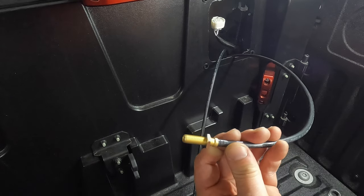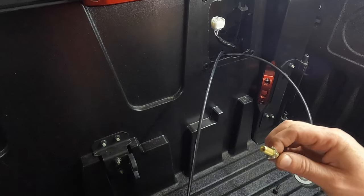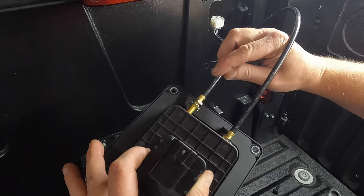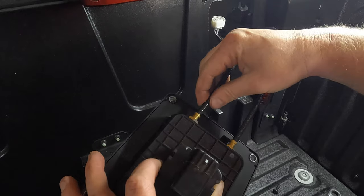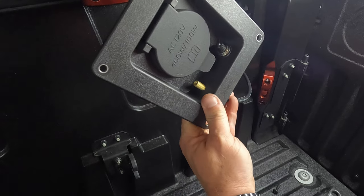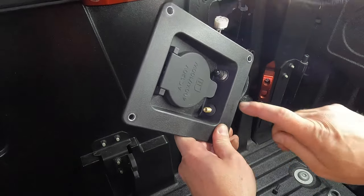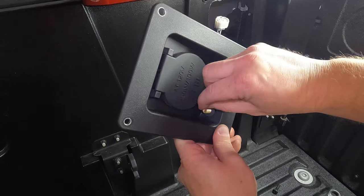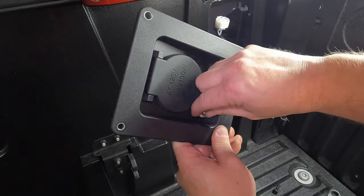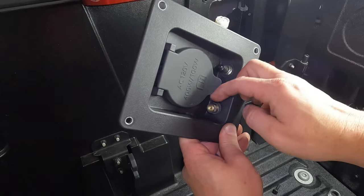So one of the nuts, then you're gonna take your star washer, put that down on there. Then we're gonna come up through, hopefully I'm on frame here. I'm trying to do this without hitting the camera or anything. Go up through the hole there, flip it over. Then we're going to take the rubber washer. Once the rubber washer's on, another flat washer. And then finally, another nut. And basically what we're going to do, just get that started there.